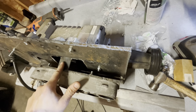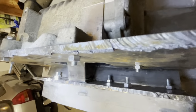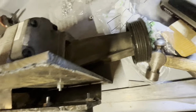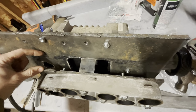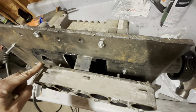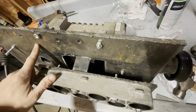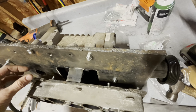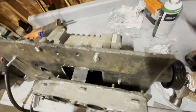And then I tacked a strap on this side, and then you probably can't see it, but maybe I can make it so you can. And then you can see there's a strap on the back side there too. And that fixes the relation between these two flange plates. So this is the one that bolts to the lower intake, and this is the one that bolts to the supercharger. So once I've got those two square to each other and the supercharger in the correct location,